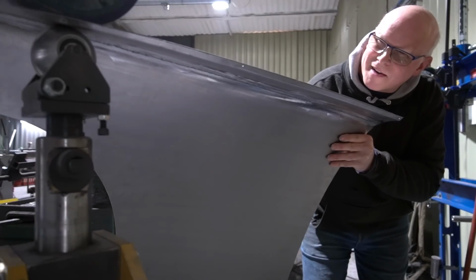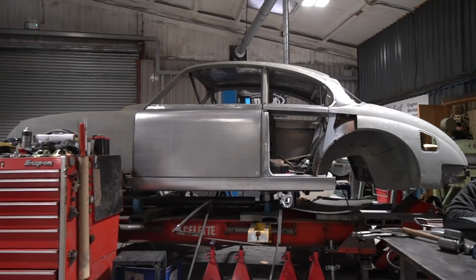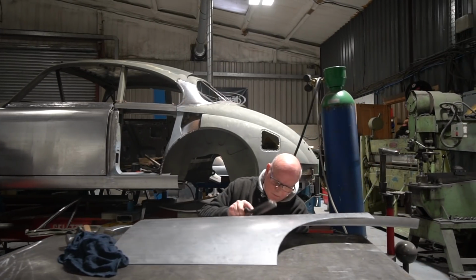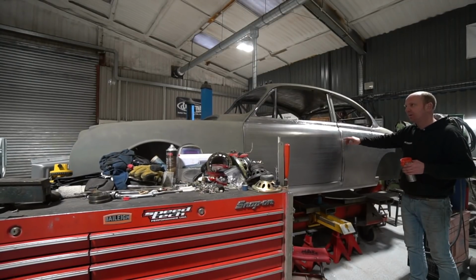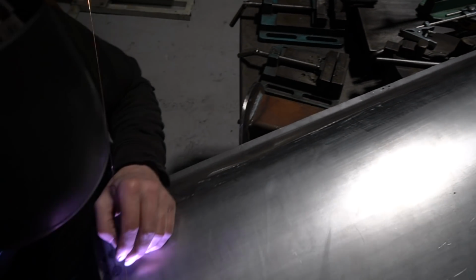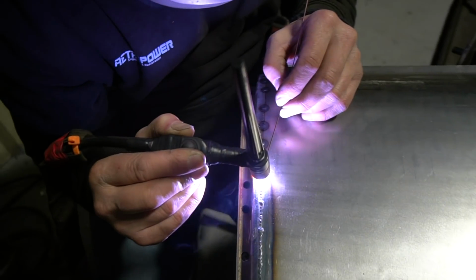He's been carrying on with that today, but I noticed he was welding this yesterday, and he's welded at the front, done a lovely job of that. We're onto the return that goes into the shut, because we kept the returns off the original B pillar just because they're quite an awkward shape. They're curved in both planes, and they've got a triple step in them, which is very difficult to shape without a press tool or a lot of trauma and potential to scrap the parts.